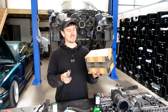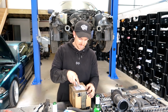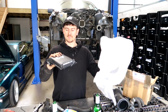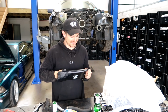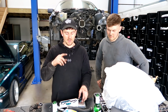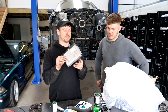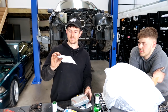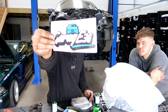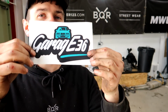In this box we have my ECU, and I had to get it sent off because, explain to these lovely people what EWS is. Oh, it's basically the immobiliser. Pretty much one of the only ways you can do a swap is if you map out EWS on your ECU, right? Yeah. There's other complicated ways, but that's just easiest. We got a comment on our channel the other day from these blokes. These are some Welsh boys from Wales, obviously, and they do a bunch of E36 stuff. And basically, they hit me up on my last YouTube video and said, do you want us to help you out with your ECU? And obviously, I needed it, so...